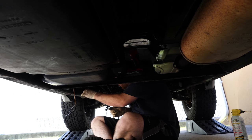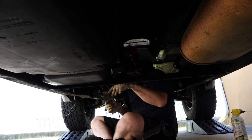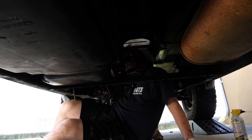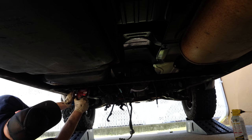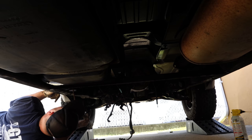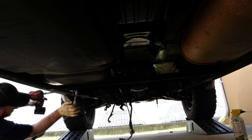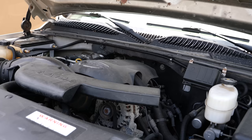I'm going to pull all these 13mm bolts out — the one holding the filter, and I think the ABS unit has to come loose too. I'm going to try to pull this stuff down, maybe cut the hard line, and then get pliers and twist the hose over and kind of yank it out that way. I just caused a lot of problems — there's a bolt and the bolt head is on the other side, so that's broken now. But it fought me, and I did manage to get the return line disconnected from the pump.